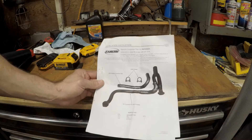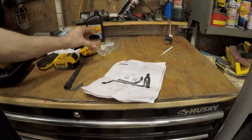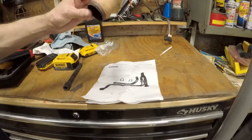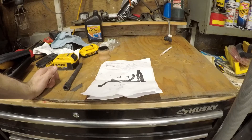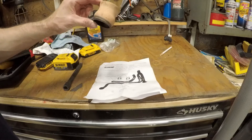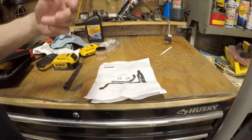When you lift the Jeeps and put in an extension, there are other companies that make exhaust extensions — and this is one right here. These exhaust extensions and the Crossover Pipe Kit itself are made to help clearance the drive shaft so it doesn't hit the exhaust. A common issue with lifting these Jeeps is that it puts the drive shaft into the exhaust system and it'll melt the plastic protective cover. Originally I tried to install the extensions, but the problem is when you install these extensions, it pushes the Y-Pipe into the crossmember.